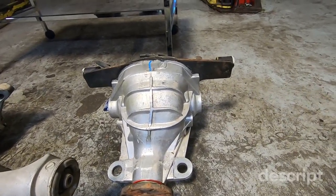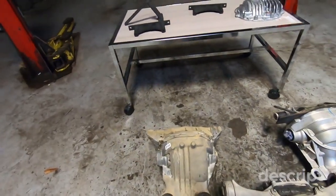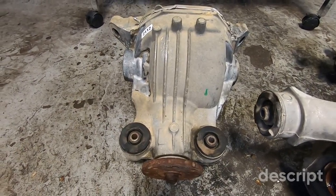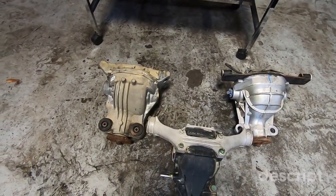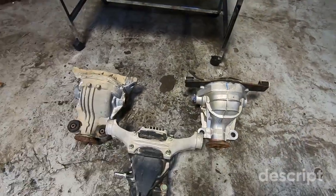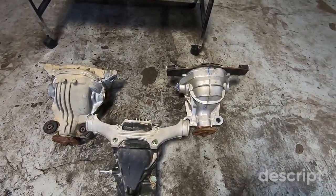There are also people that like using the Explorer 8.8 because they are easier to find. They do not come with limited slip, so you have to put a limited slip diff center section in it. These two differentials in the back, which are 8.8s, have 3.55 gears, which are a lot more ideal for the RX8 with a V8. If you're trying to make over 400 wheel horsepower, I would highly recommend using one of these.